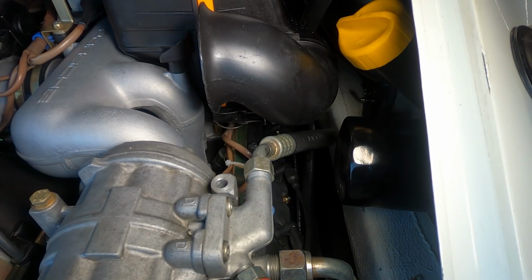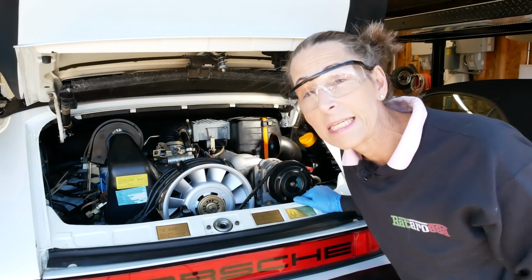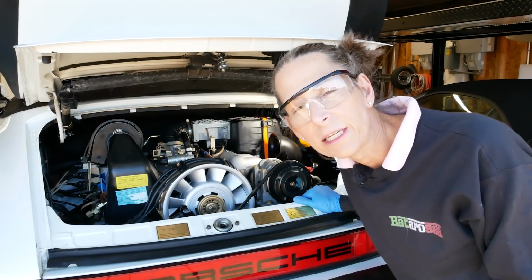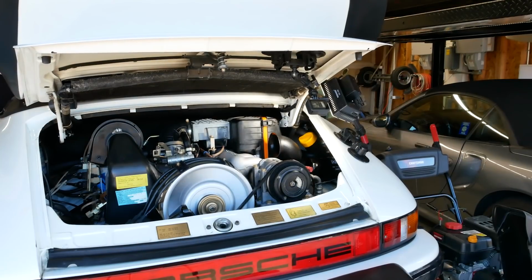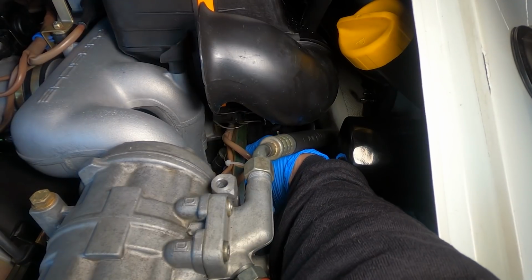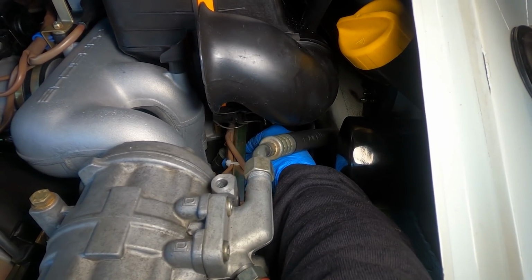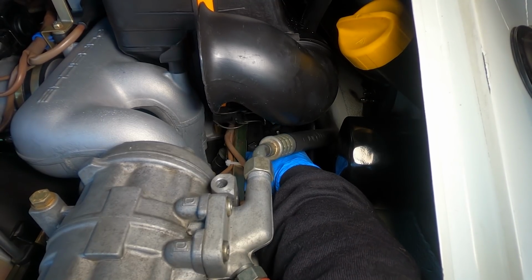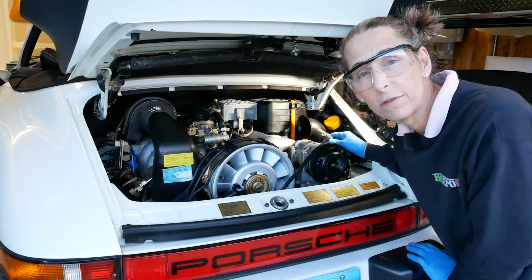And we did plug in our fuel injector, yes. Yeah, that's plugged in. All right, well, this was step one, so let's give this a try. We have a nice clean spark plug. Let's go ahead and see if this cylinder is actually going to fire. Let's go ahead and pull the injector wire and see if it slows down. That's this guy here. Yeah, no difference. That's it disconnected. That's it connected. No difference. All right, so this is just a process of elimination.